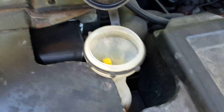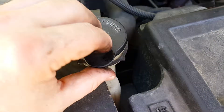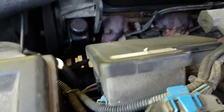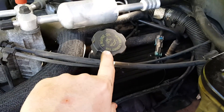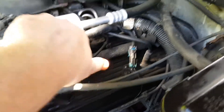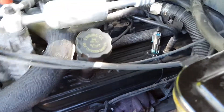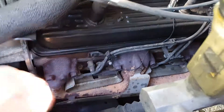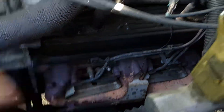This is washer fluid — it's not a necessity at all. I believe mine is empty, but the little yellow floating thing is actually where it shows how high the fluid is. Then this is where you would add engine oil if you need to. If you're not going to a shop, you undo this cap here and put a funnel in, or you can just pour it in yourself. You don't want to spill though — if you spill down here on the manifold, it's going to smoke a little bit. So definitely don't spill on this. These are your manifolds that go out towards the exhaust.